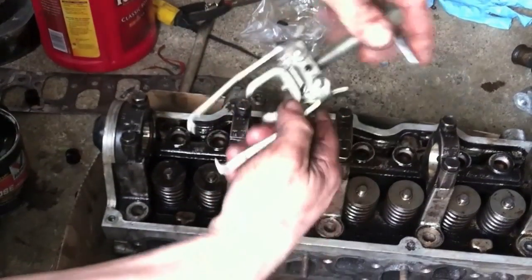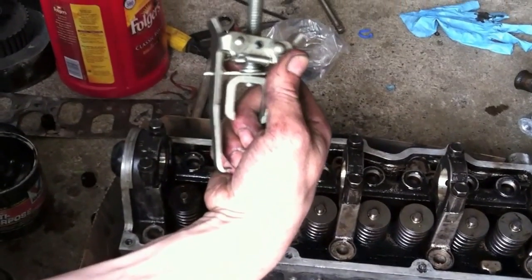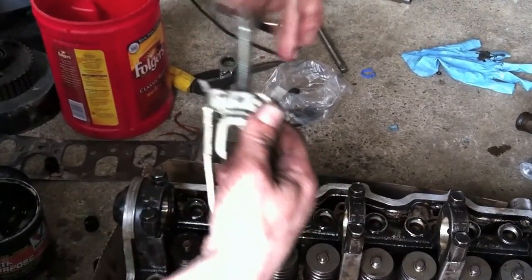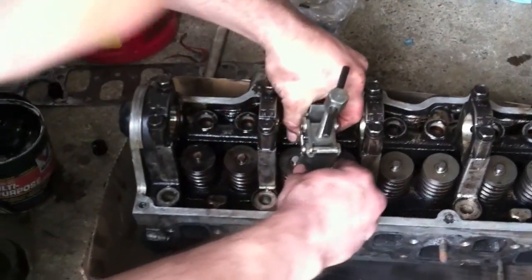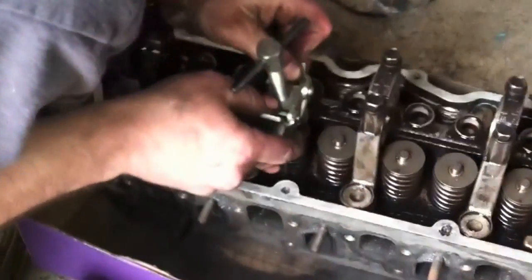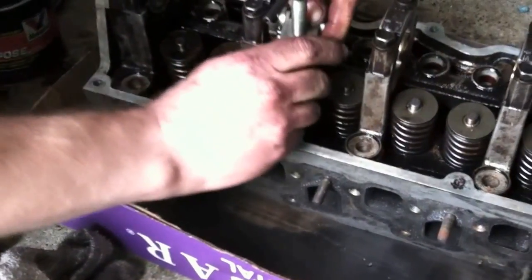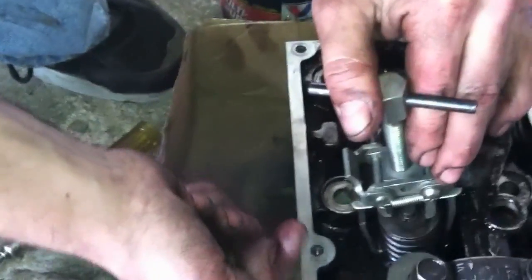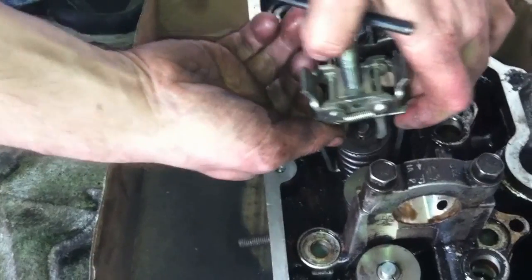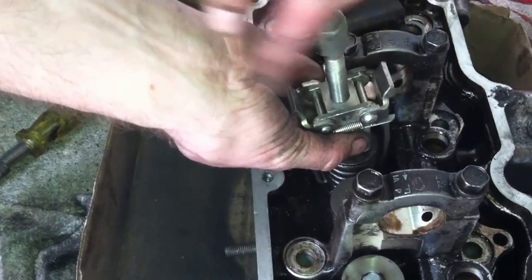You put it on there. This screw raises and lowers this thing, so you want it all the way up. You put this on here and try to get the lowest coils of the spring that you can. Not always the best two lowest coils, but try to do it. As you can see, this opening here — you want to keep that somewhere that you can get to. So keep these jaws in and try to keep this thing from spinning while you're tightening it.